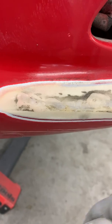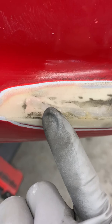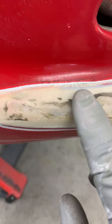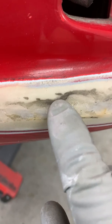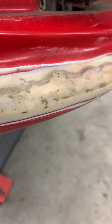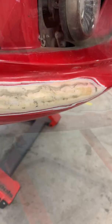This is why it's a good idea to use a guide coat, because some sections look like — if you didn't have the guide coat — you've got it nice and even and flush, although you can feel it. But with the guide coat, you can see where you've still got low spots or high spots. Using a guide coat is a really helpful piece of kit.